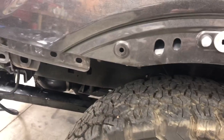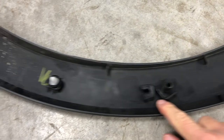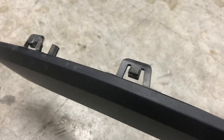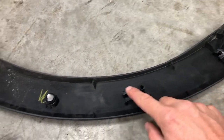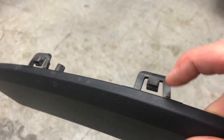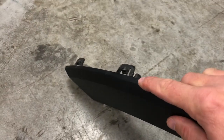What they don't tell you is that you've got three plastic clip pieces, but then down towards the edge there are three tabs. If you keep jerking on the piece and break one off, it's not going to stay attached to your front bumper anymore. Once you get past the first three clips, pull out gently and you'll be able to see the front tab. Just push down, stick a screwdriver between the piece and the front bumper, put a little pressure on that tab, and it pops right out. Then get the second and third tabs and the piece comes right off.